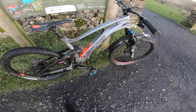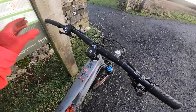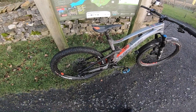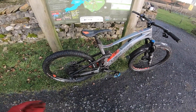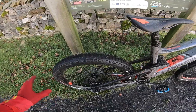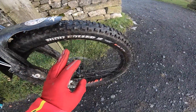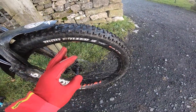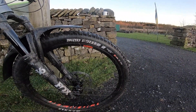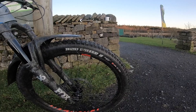It just feels really natural as soon as you jump on board. There's a 35mm stem, standard 780mm bars, and the whole bike just sits together straight away. I've had to do very little in terms of learning the bike and setting it up — even straight into the first turns it felt really well balanced. Tyre spec is a 2.5-inch High Roller both ends — a classic, super-grippy tyre — and it's in 3C MaxTerra compound, so not a reinforced sidewall. If you're regularly hitting rocks you might want to go to EXO+, but Gisbourne is not an easy ride for a tyre and it's been fine.